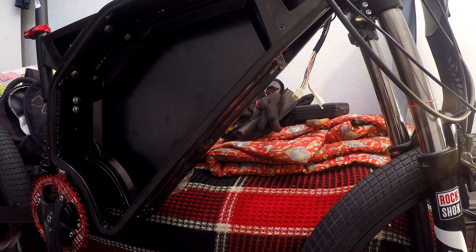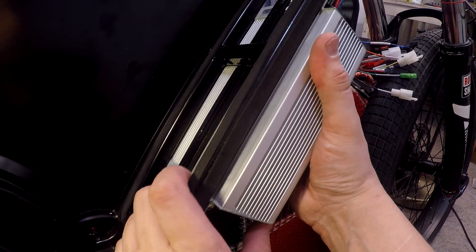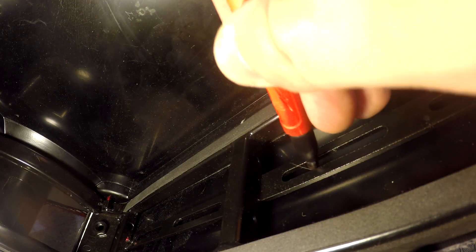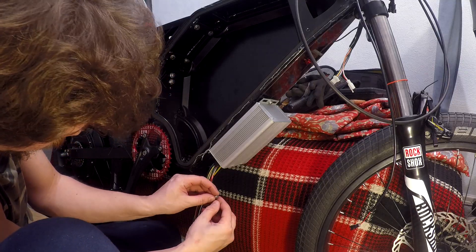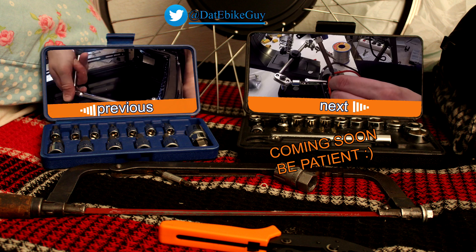Since the plan is to add a very large battery pack, the controller has to stay out. The plan is to put it under the frame. I'm marking the controller dimensions onto the frame and then onto the bottom cover where I'm drilling the holes. I choose a drill bit that is a bit bigger than the body itself. To make the drilling better and safer I make small holes in advance so the drill goes where I want it to go.